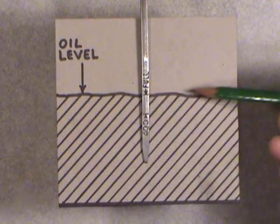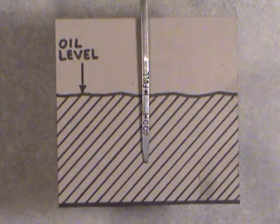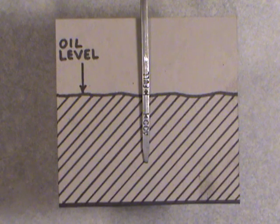Now the way I've got it set up right now is what I have to do is simulate things. Okay, what I like to do, I'll mention too, is I check my oil first thing in the morning before I go anywhere. That gives the oil a chance overnight to drain back into the oil pan. That way I know what's really in the engine. And you also have to remember too that your oil filter holds, on average, a quart of oil, or a liter if you're using the metric system. Generally speaking, a smaller car might be a bit less, maybe half of that amount.